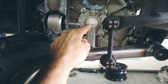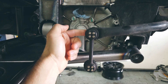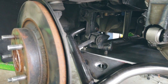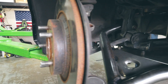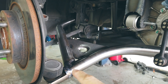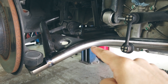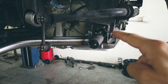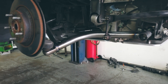This is the motor side of the drive unit. We still have a couple little things to address — we're going to put a spherical heim joint right here and then do a lower arm mount, which should all be done today. You can see the lower arm that Chris did. We basically had to dog-leg it — this is kind of the factory path, and then what would normally go straight, we had to dog-leg about eight inches back and then put a heim joint in that direction.